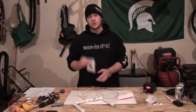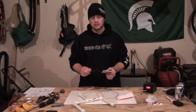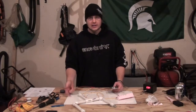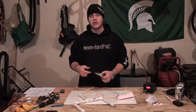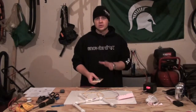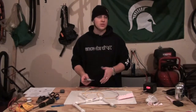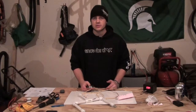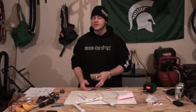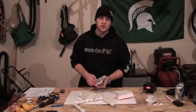The first thing you have to do when you have these wires is measure out a foot, because that's going to give you your ohms per foot to figure out how much wire you need to provide adequate resistance to your circuit. In most circumstances you don't need to add much more than 3 to 4 ohms. This wire is 0.3 ohms per foot.